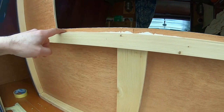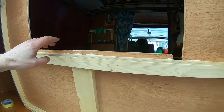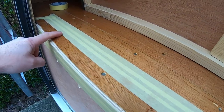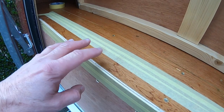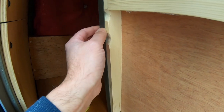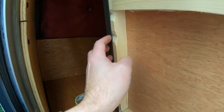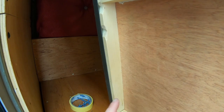This is the wall I've made. It's simple construction - plywood, softwood, glued and screwed together - and I've cut the aperture here for the window frame that I made, and that fits in there nicely. This area is masked off because this is where the Sikaflex EBT Plus is going to go. I think the EBT Plus is flexible enough to allow the wall to move a little bit when you're driving along with vibrations, and that should hold it quite nicely without cracking. I've recessed some little pieces here to sit over the screws on the inside of the truck, and I've put some neoprene on there just to stop it rattling. I want this wall to be removable ultimately, so that's why I'm doing it this way.